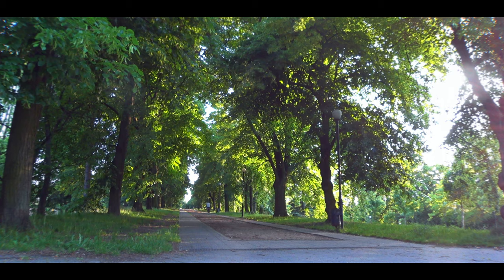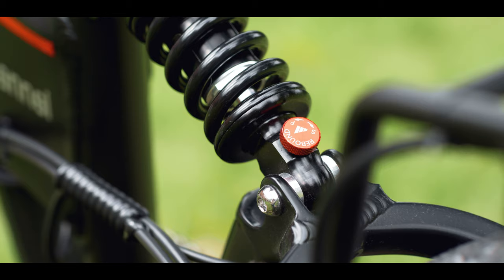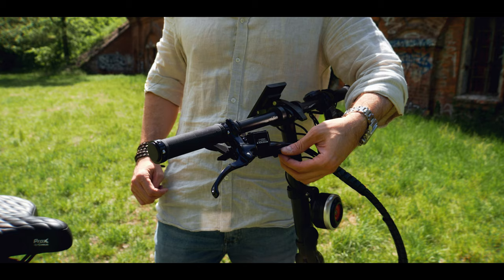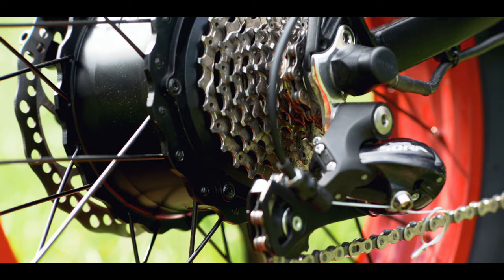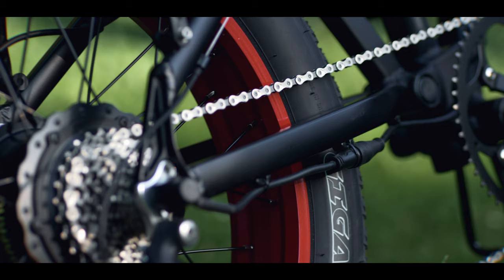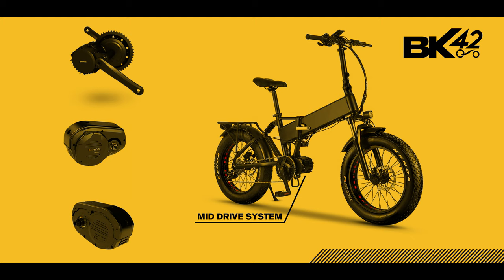This motor is powerful enough for any steep hills. It comes with full suspension; the rear shock has adjustable stiffness, but even at its softest setting I found it to be too hard. The front suspension can be adjusted as well to match my riding style. I got the Tektro hydraulic brakes with motor inhibitors which override the powerful motor. They are not the best hydraulic brakes, but they are pretty good. The 9-gear system is cheap but does the job, and it comes with a Shimano derailleur. Because of the powerful 750W motor, I can ride the bike with or without pedaling support, so shifting is not as frequent compared to pedaling a normal bike. Although it is a cheaper drivetrain setup, the rear hub drive means these mechanical parts will only be subject to normal rider pedaling power. If this was a powerful mid-drive bike, I would assume these cheaper components would likely deteriorate quite quickly.